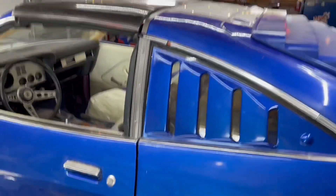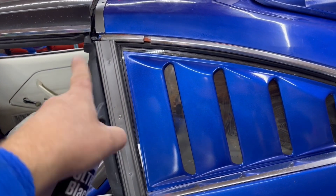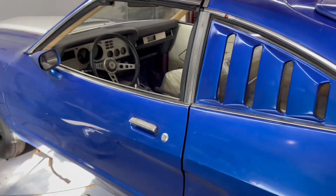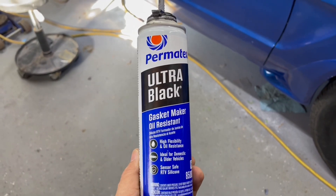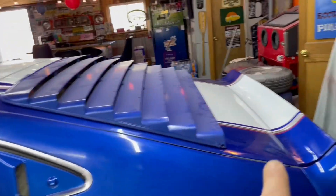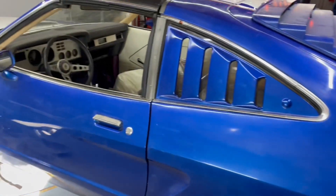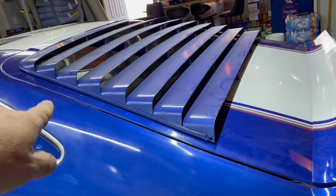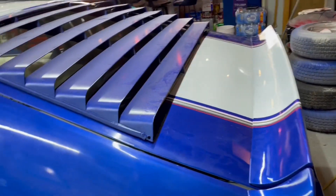What I used — there's the other side. This side I put three rivets. I should have only done two, because after I did this side first I realized I shouldn't have put the one in the middle. I may do something new — swap meets will be coming up pretty soon, I'll find something. I used Permatex gasket maker. I just ran a bead of it all the way around and then started putting the rubber down. It was kind of a pain putting that down by yourself because that long piece of rubber would have helped to have somebody hold. What I did was put it in place and then taped it as I went, and got it all around — turned out pretty good.